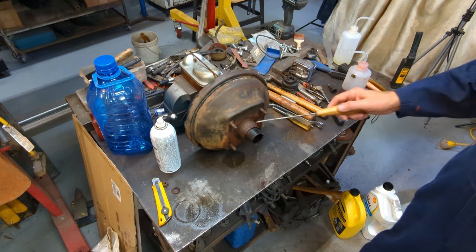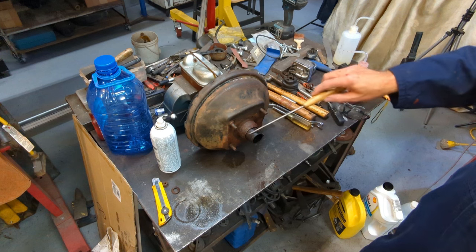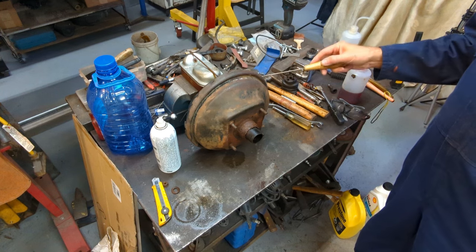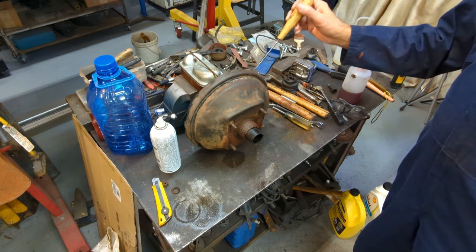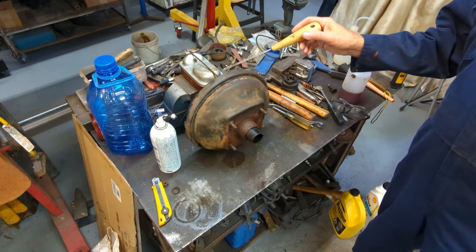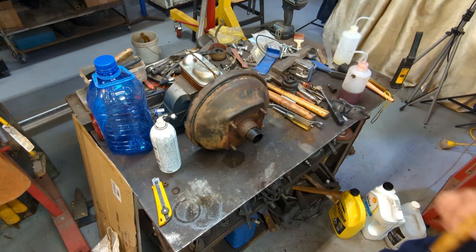So here's the brake booster. This whole end is rusted off. I believe there was a collar on that, but it's gone. It was only $123 for a new brake booster. And I get a new check valve, which this one is completely deteriorated. You can't see it, but right there, that check valve, the white piece that goes in on the vacuum line. The master cylinder doesn't look terrible on this. It looks like it might not be that old, but I'm just replacing the whole thing.